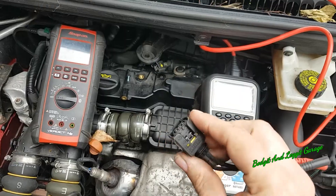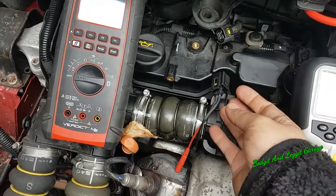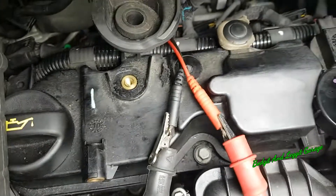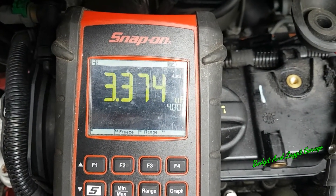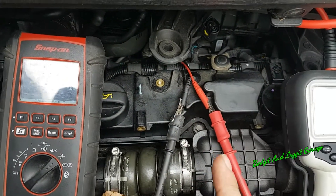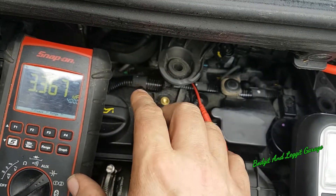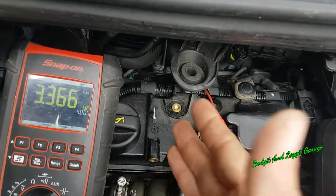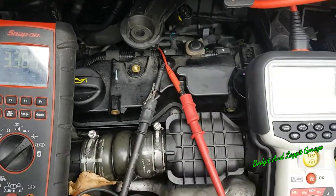I've made my own lead here which I can just put to any banana plugs - really handy. I'm going to clip this on first and do a microfarad test. On these injectors you're looking at about 3.4 to 5 microfarads. Each injector is slightly different so you need to know your spec. As you can see, that's within spec - not that far out, so it passes that test. Just because it passes three or four different tests it only has to fail one. I've seen these injectors pass an oscilloscope waveform looking perfect but it's an intermittent fault - this kind of testing can find them where an oscilloscope requires perfect timing. We've passed the wiring, ECU, and microfarad tests.